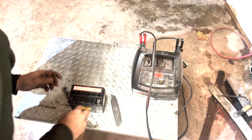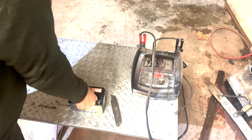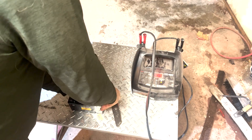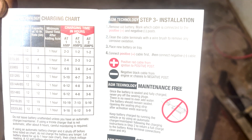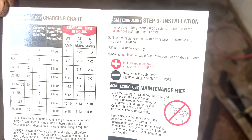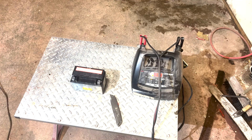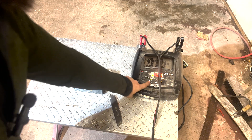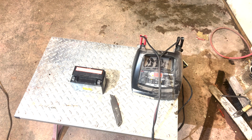Try not to get any on you. Put this over the top and push this into place. Minimum stand time after adding acid is one hour. And then when you go to hook your battery up, hook it up on the lowest setting, which will be one to two amps. Then you're going to want to charge that for another couple hours, or you can read the sheet and that will tell you depending on what battery it is.